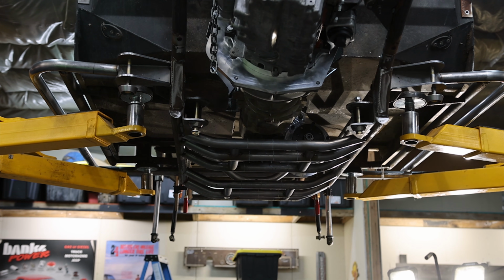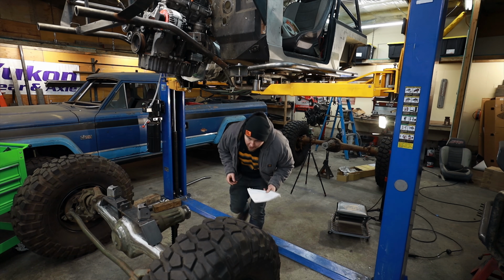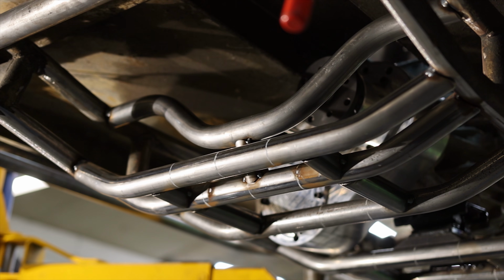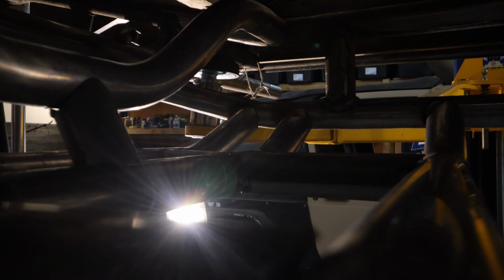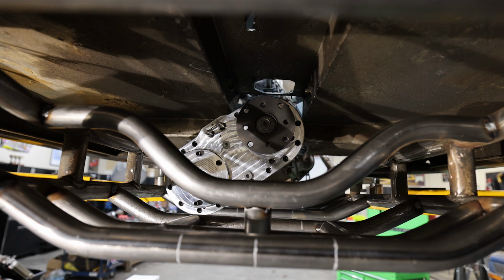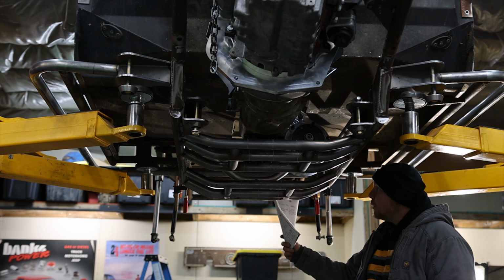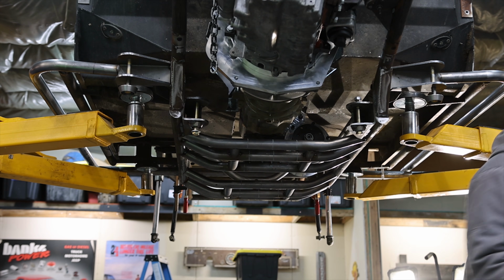Now, the rear cross members, I designed it very similar to the front, but because I had the opportunity to add an upper cross member that ties into the upper part of the frame rails, that's going to give us rigidity in keeping things from sliding side to side. Now, a lot of factory frames and stuff don't have a full-size cross member that would go from the top of the frame to the bottom of the frame. But when I saw the opportunity to use this and I'd already bent the cross member up, I was like, man, this is going to add a level of rigidity for very little. There's very little cons associated here. So I decided to keep that cross member, and because the rear suspension is going to tie into these cross members, it's going to give us a really stout place to mount.